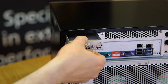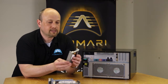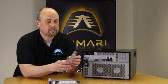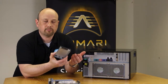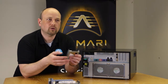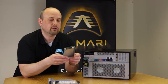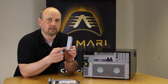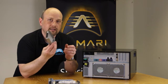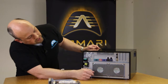In the back there are 2 SSD bays. Currently there's one SSD installed, but it supports two and is hot-swappable. If you're running a FreeBSD or ZFS-based operating system like FreeNAS or Nexenta Store, you can put the L2ARC and ZIL cache into these two SSDs. The tray just slots in and is secured with a single screw.